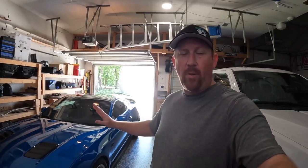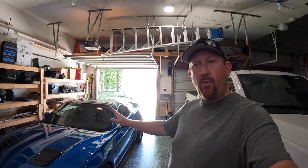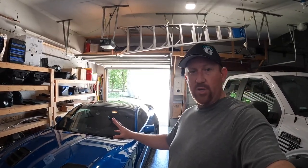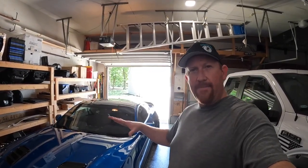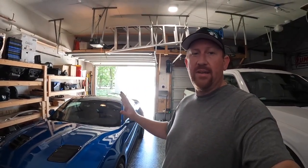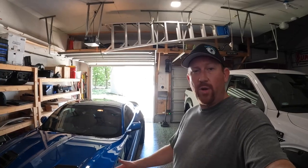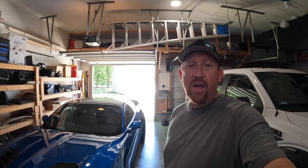I still need to get it back to the track, put a little smaller pulley on it, a little more boost, see what it'll do. But right now a 10.50 car is perfect. I just wanted to bring you this little video and show you guys the weight of the car with the ESS supercharger. The car stock without me in it was like 3,740 pounds, so basically the supercharger and everything is about 60 pounds heavier than stock — which makes sense adding supercharger, intercooler, piping, that kind of stuff. Give me a thumbs up on the video, subscribe to the channel, drop me a comment, let me know what you guys want to see. Keep it boosted, keep it positive — we'll see you later.